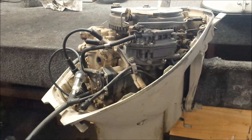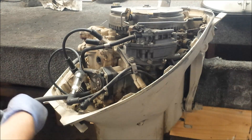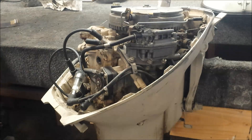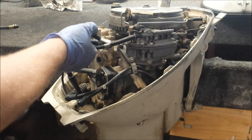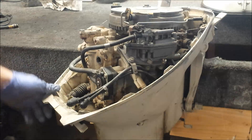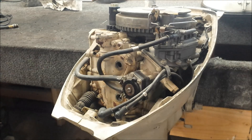60 also. And we had spark. So the power head's probably in good condition, and so is the ignition system. But we'll pull it off — pull off the flywheel — and we'll see if we have any cracked coils or anything weird going on inside of there. But at least we know it works.